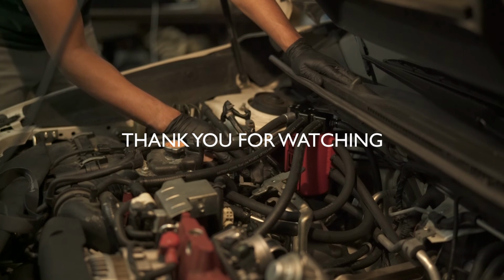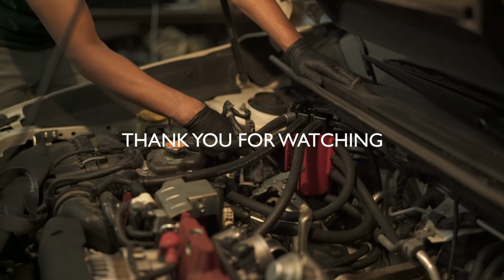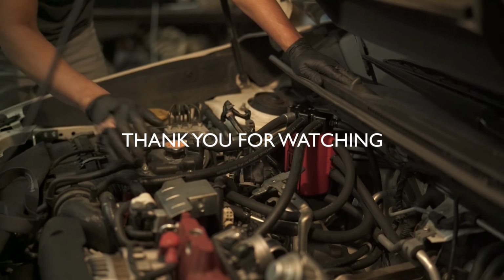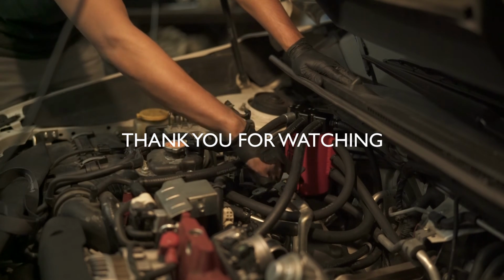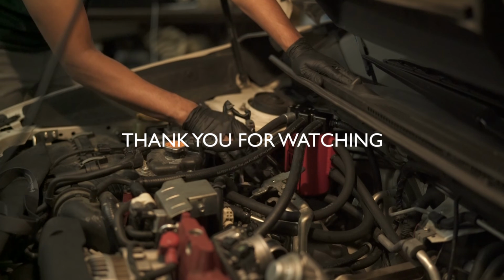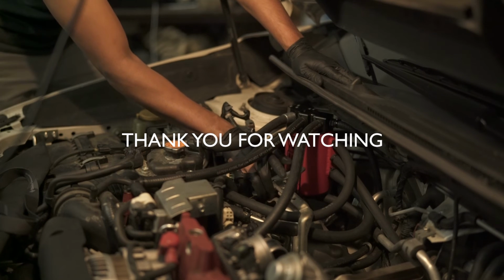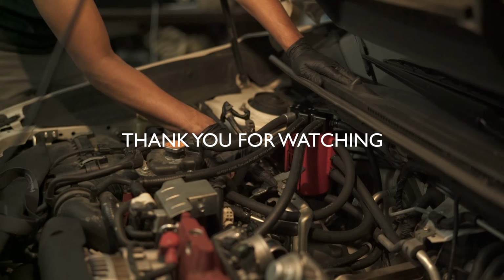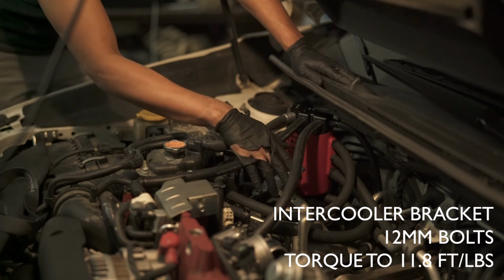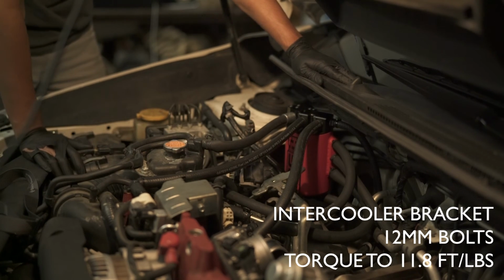Got the wiring harness installed. It was a bit of a pain in the butt. You just had to pull, yank on it, get that 10 millimeter bolt in and bolt that in. Removing this bracket helped a lot in maneuvering around. I think it was 12 millimeter bolts or something like that. Both of them I torqued down to 11.8, 12 foot-pounds, according to the service manual. We are going to just put on the intercooler now.